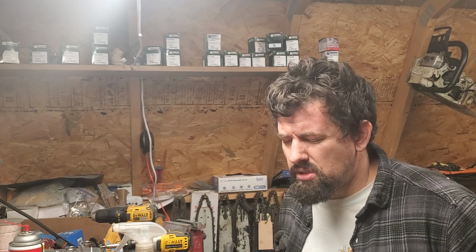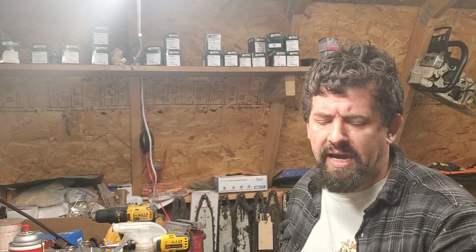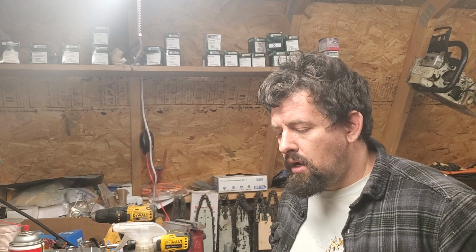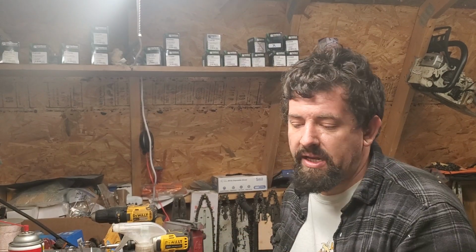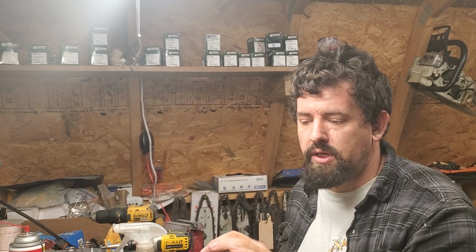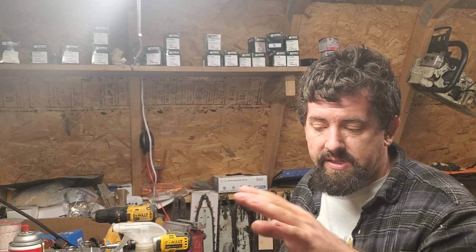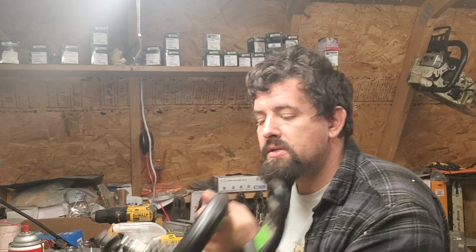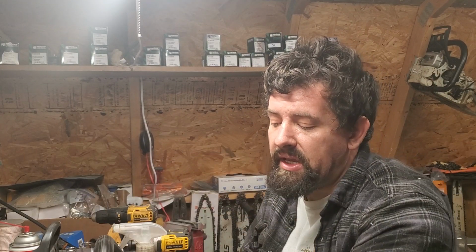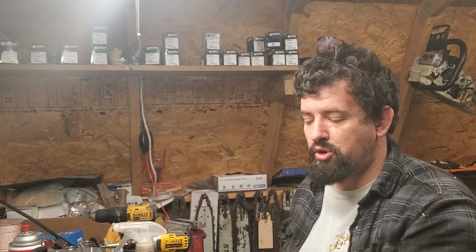It's such a slow leak that most guys wouldn't even care about it or think it would matter, but to me it does matter. And so this saw did not get the top end removed. I did a vacuum pressure test on it, and that's a video I have on the camera. Hopefully by the time, if this gets listed online, I'm able to get that off the camera because I want to show that video since there's no photos coming on this top end being removed. It's not been removed. I've done a vacuum pressure test.